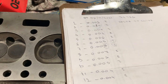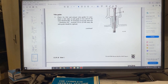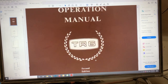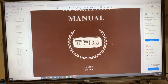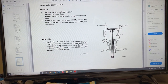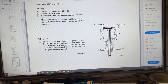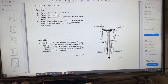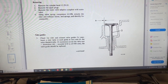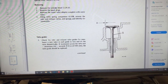I have this brown Triumph Motors / British Leyland manual on my computer. On page 78 of the PDF it shows valve-to-guide clearance — they call it 'running clearance.' According to this manual it's 0.20 inch or 0.508 millimeters. But when you convert 0.508 millimeters into inches it's actually 0.020 inch, so that's definitely a typo — it's not 0.20, it's 0.020, which is 20 thou.